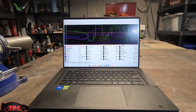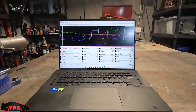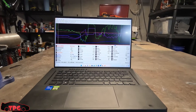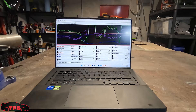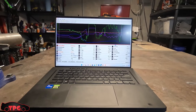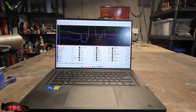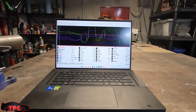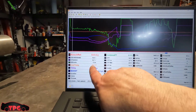This car is still equipped with AC. It was about 94-95 degrees out for a few days and I was driving up to my day job watching the cooling temps start to climb. The car would sit between 196-197 and 206. It would hit 206, the fans would kick on, bring it back down to around 196. But on a really hot day with the AC running, the fans just couldn't keep up. You can see in this log we hit 213 on that day.